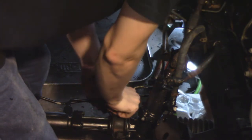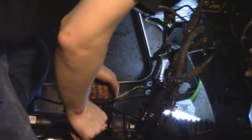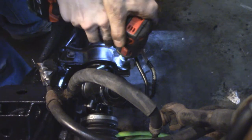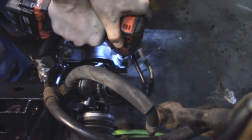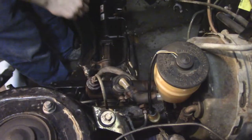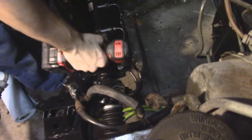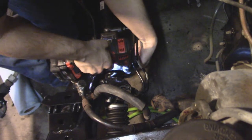These being polyurethane instead of rubber, the bracket on the driver's side just would not line up for some reason. This is the one that clips into the subframe, and the bottom bolt hole just would not line up correctly and was not really close enough to the subframe.